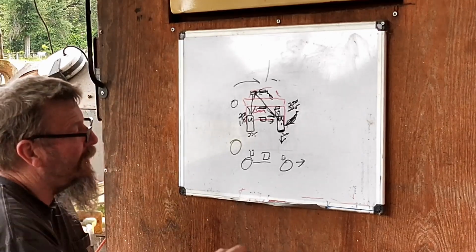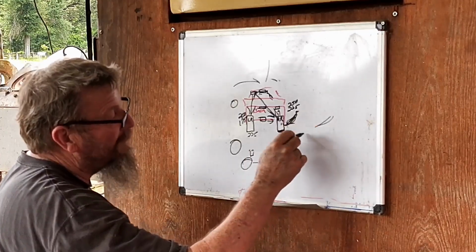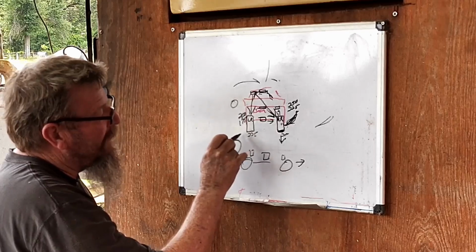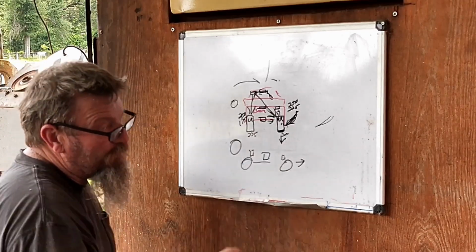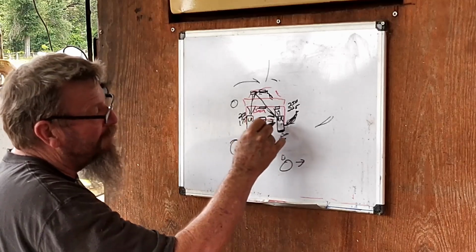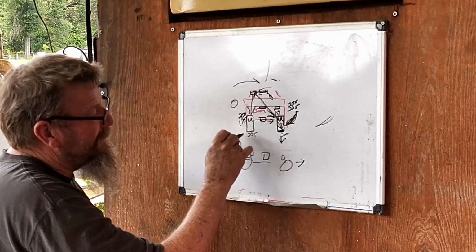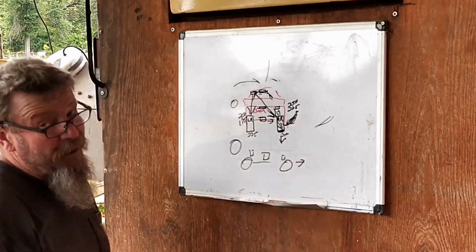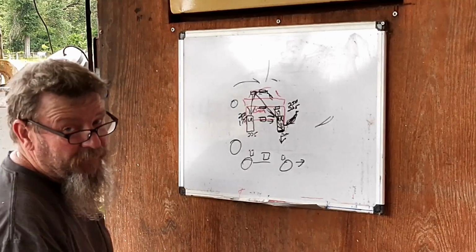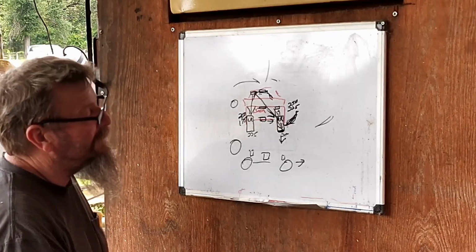I think my car, if you've seen the other videos with the long shackle, has a lot of droop on the left rear. It'll droop way down. So I like that being softer, having a lot more preload in it. Even though our scale numbers are the same, I think in body roll we load the right rear harder, and this still stays in decent contact. And I don't have any weight on the 723 car. It's old and it's heavy, but it still gets off the turn good, and that's that.